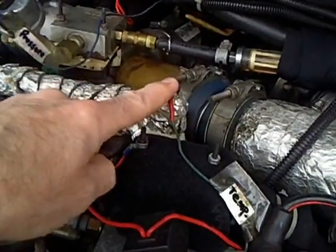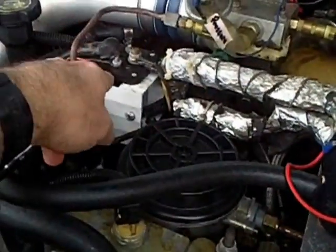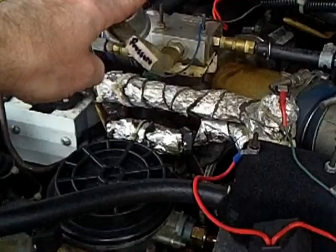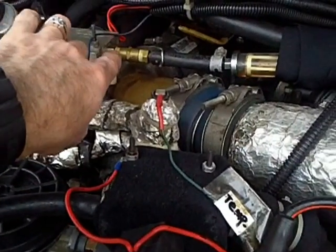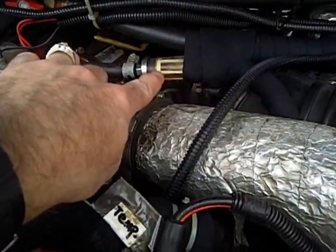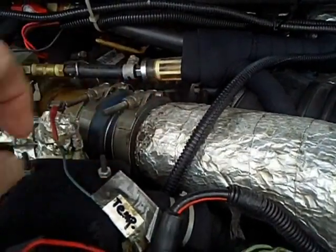This is my temperature sensor right here. It goes down these lines, feeds the engine, and I have a fuel return here which allows me to circulate. I measure the pressure of the fuel right here. And if I'm circulating the vegetable oil, it will go through this path here — I can check for any bubbles or just monitor the fuel as it's going through.